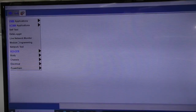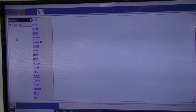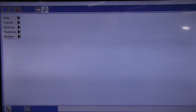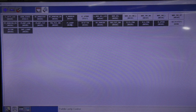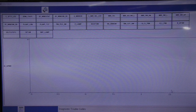I decided to plug in and do a diagnostic check using the IDS Ford scanner — you can also use an Autel or any Snap-on scanner. Going into the driver's door module for a quick check: nothing, pass, no codes. I tried the data logger — depending on the module, you can sometimes view live action as you push buttons to see the fold-in mirror state. But as soon as I opened this module, I could see there's very limited information. Body control modules don't get as much data as engine, transmission, or ABS modules. I selected everything just to look for any clue about the fold-in mirror.